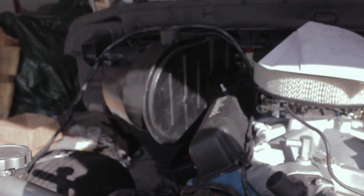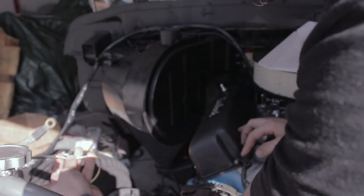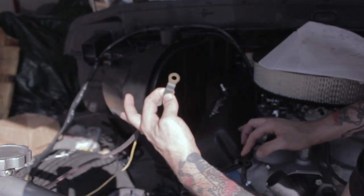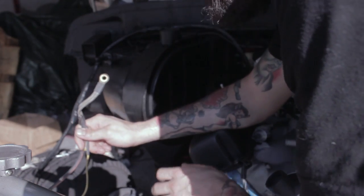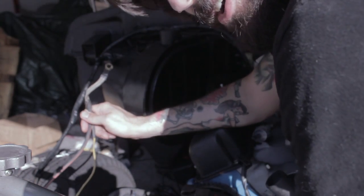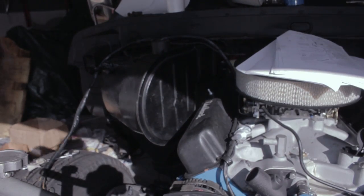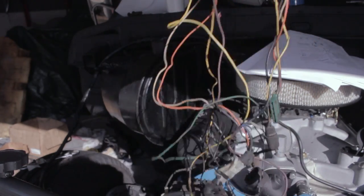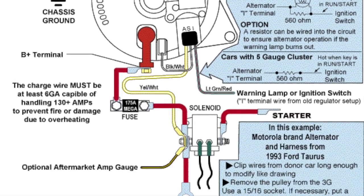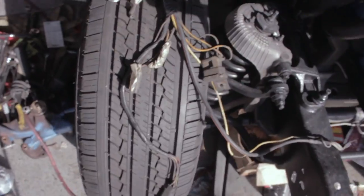For the wiring, it was really easy. We used a wiring guide — I'll throw a link in the description — it's a 130 amp 3G alternator installation for a 65 Mustang, and it worked the same. Not a lot of differences in the old Fords. As I said in the earlier video, when you find this alternator in the junkyard, there are going to be three wires coming off of it: one big one, a smaller yellow wire, and a green wire. When you go to pull it, get the harness all the way to this fitting — you have to cut the harness out and get it. Get the entire length of those wires because the Taurus has a much smaller engine compartment than your truck. Since this alternator is internally regulated, all that old wiring going to the regulator gets chopped out and replaced by those two wires, so you end up with one clean wire going back into the harness.